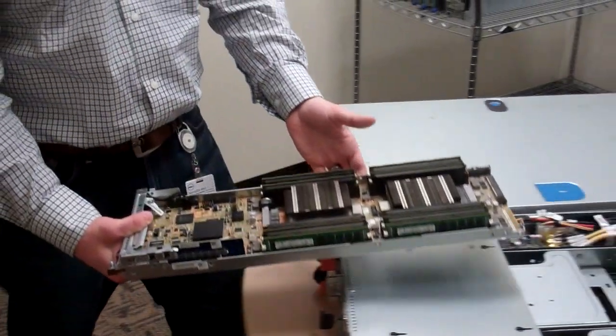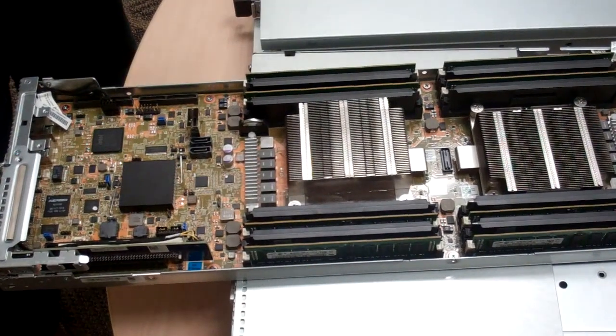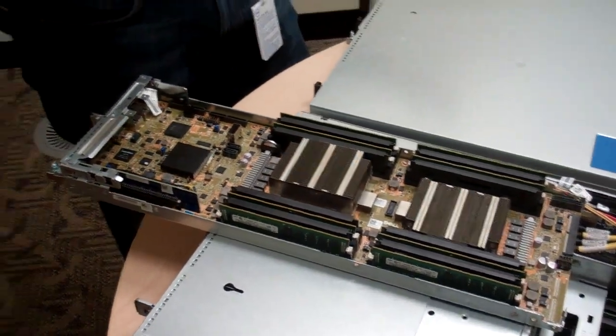The main headline in this generation is Intel's new E5-2600 processors, which this system will support. The E5-2600 is Intel's highest-performance two-socket processor, and it goes along with the product's tenets of being extremely dense, extremely high-performance, and high performance-per-watt. You get a couple more cores and a huge leap in performance. Via changes we've made on the board, you can now support up to 135-watt processors — compared to a cap of 95 watts on the C6100.